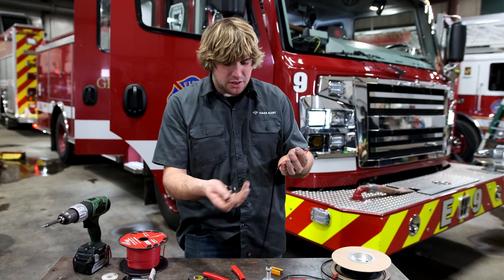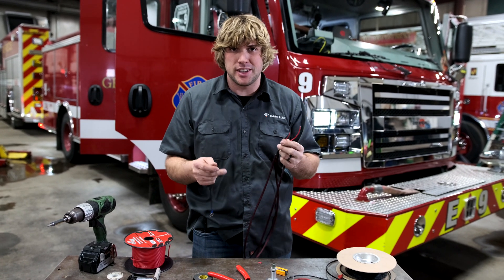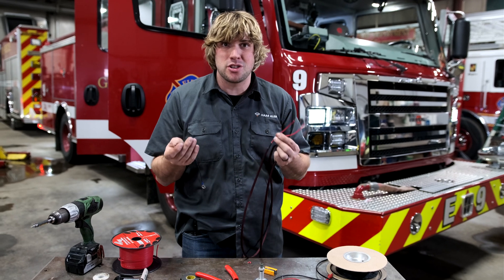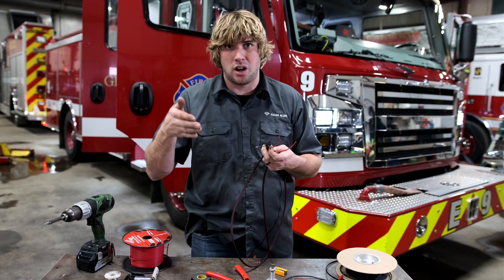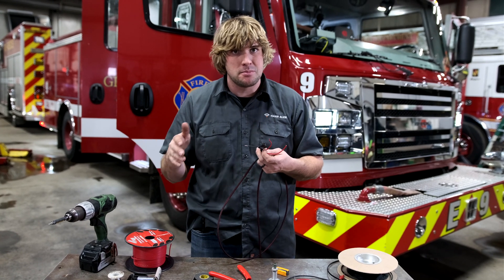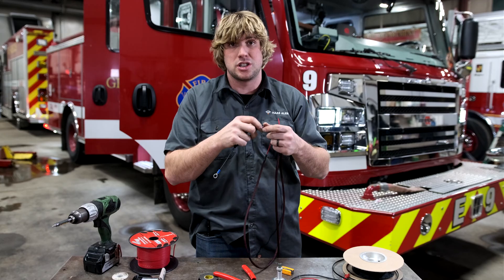What I'm doing now is putting together a short wiring harness that's going to go from that center console down to the area where the HA5 is. Keep in mind, if you're installing anything in a fire truck, you need to make sure that the circuit is protected with a fuse. If you're an OE manufacturer installing on a new truck, you can do this in the multiplex system, but in the aftermarket you want to make sure you've got fuses on everything from power to switch as well.